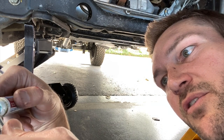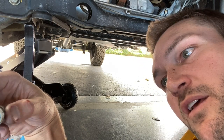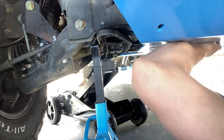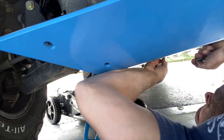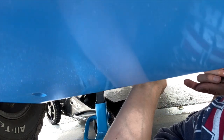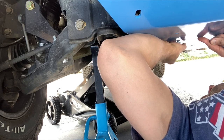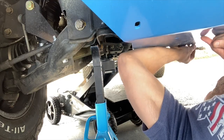Now you don't have to put Loctite on there, but because these bolts are facing downhill and we're actually planning on bringing this vehicle off-road and not just to the local shopping mall, I'm putting on some Loctite. If I was smarter I would go get another jack and hold this up, but most of you at home don't have multiple jacks so we'll try to do it the low budget way. And of course don't tighten any of these until you get them all in, because you probably won't be able to get the others in if you tighten the first one way down.